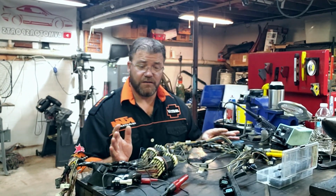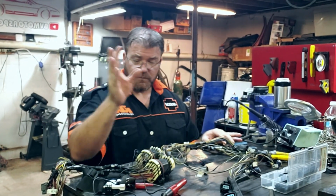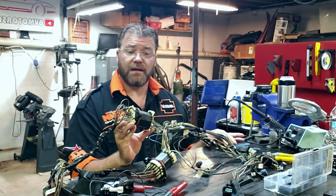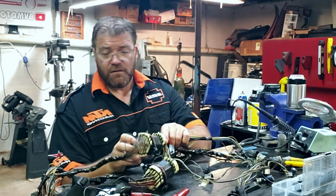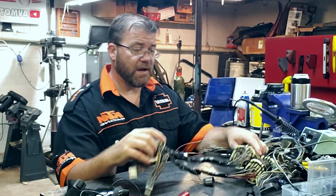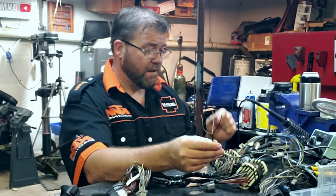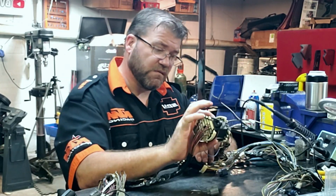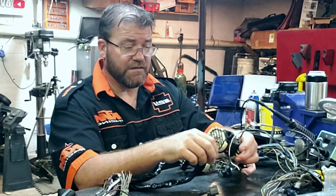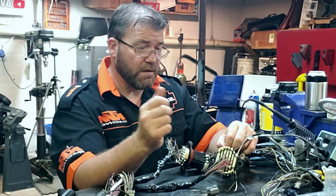All right. What are we doing here? Well, obviously the video is continuing. I am working on the wiring. Got to sort out the pigtail for the vehicle speed sensor. And I also need to double check the wiring in the bulkhead fittings. I think I've got the VSS pinned incorrectly, because this wire right here is the signal wire, and it's not matching up in the bulkhead fitting, which I believe was this one. So something else I've got to check is I'm just going to go through and make sure all these are the same, and see what's what. So let's get working.